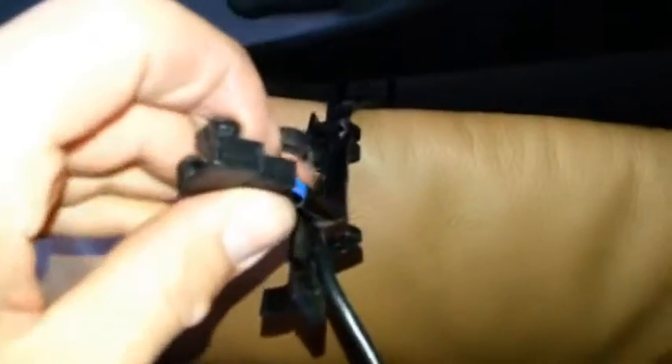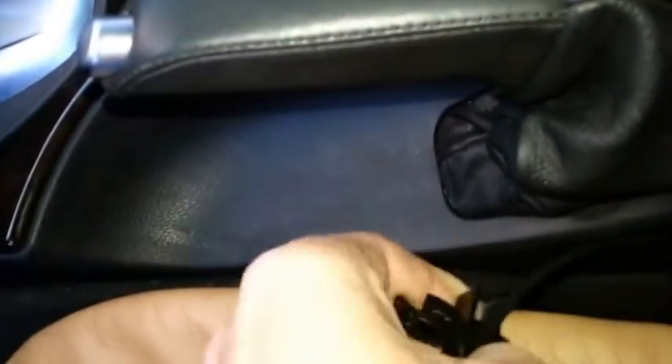Now, this one cable that was on the top and that yellow thing has to come off these brackets. Try not to let it drop down because you will need it for the new seat belt buckle. So that's the old one — now here goes the new one.